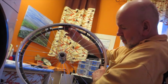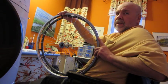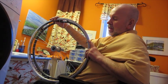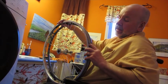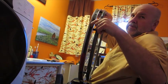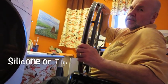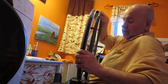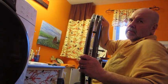This tire has had about five holes in the last six months. I marked the tire when I took it off to show where I found the hole in the tube. I put the tube in water in the sink and found a hole — and another hole that's going to happen. They're almost exactly the distance from one side of this protuberance to the other side, and they're wearing the tube. We think the rubber covering that protects from sharp metal on the rim is wearing out — we can feel it.